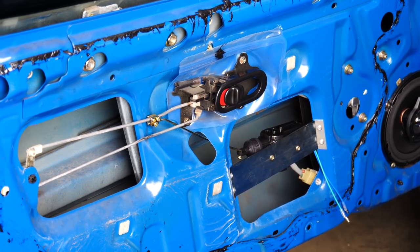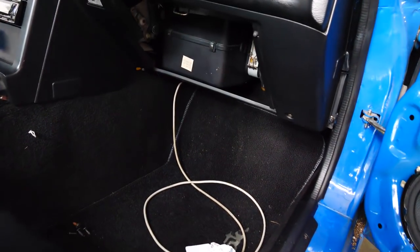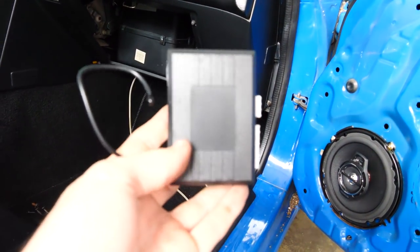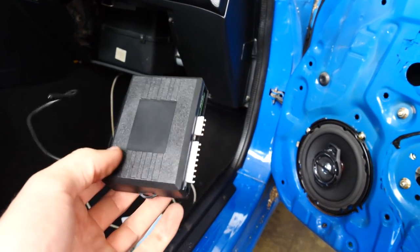Both of the actuators are now in the doors and they are actuating — they're working. Now we have to mount the control unit and wire it up. 99% of the wiring is already done; all we have to do is connect a power and ground and then connect it to the antenna of the car. I don't have an antenna on the car — I took it off — so I went ahead and bought a cheap short black one from AutoZone that looks much better than the factory one. I'm choosing to mount the control unit underneath the dash, underneath the glove box on the firewall. The nice thing is it mounts with just sticky tape — no drilling, no nothing, you just put it wherever you want.